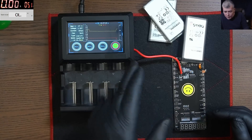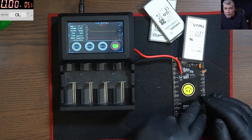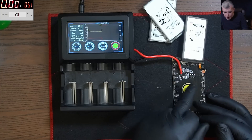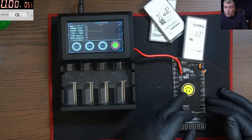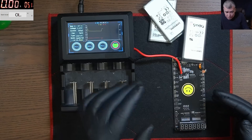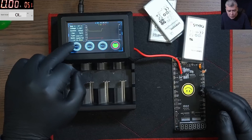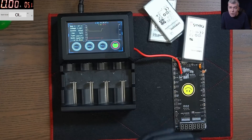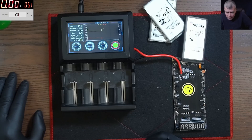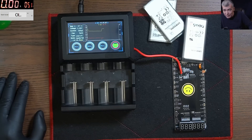This is the EBL charger. You can buy any activation board — I think that's what it's called. If you take two wires from plus and minus, you'll have plus and minus on every connector and you can plug any battery, charge it, discharge it, and even do a short internal resistance test. I think this is very useful in a shop — you can see how good a battery is compared to another one, roughly, because a bad battery will have a very high internal resistance. Okay, so I'll stop now. Thank you for watching — like and subscribe if you liked the video, and probably see you on the next one. Bye.